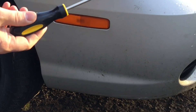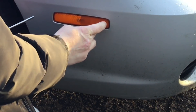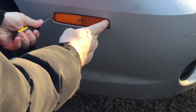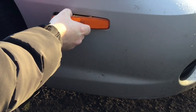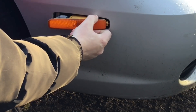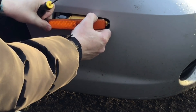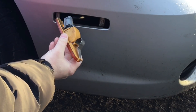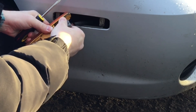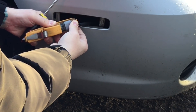This is the bulb that it's going to replace behind this side panel light. To replace it, press in the front and use a little flat screwdriver to wedge that out — it comes right out, very simple. There's a little metal clip that holds it in, and it just takes a little bit of finagling to get that clip off. Then we're going to remove the power cord for the light — there's a clip that you have to squeeze.